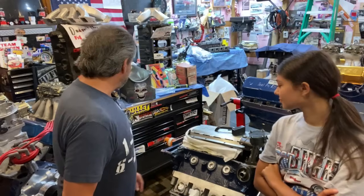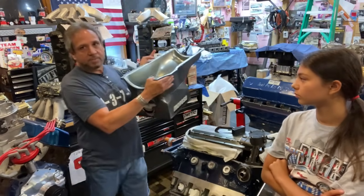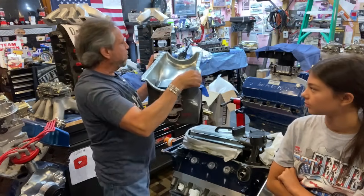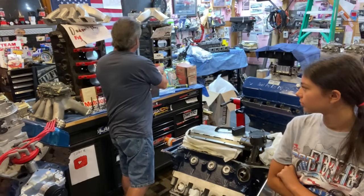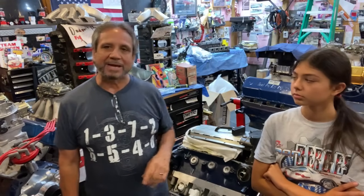The plan is I'm getting rid of this oil pan. This is a pan I ran for a long time — nine quart, never had an issue. I talked to Stan at Steff's. He said send that to him with a new oil pump and they'll fabricate a brand new oil pan and pickup. I'll never have to worry about this again.